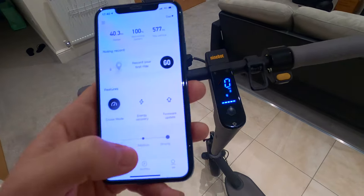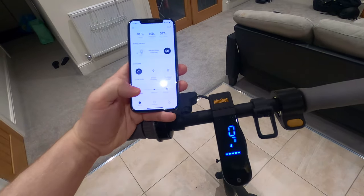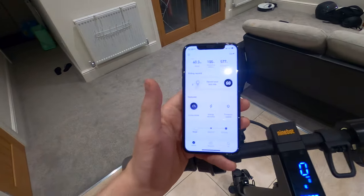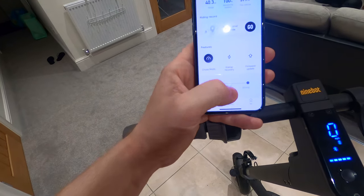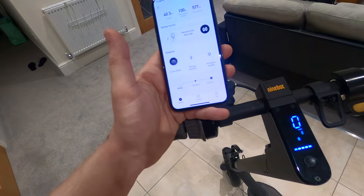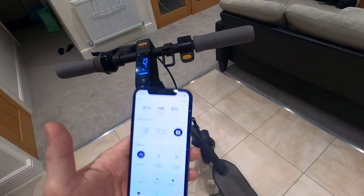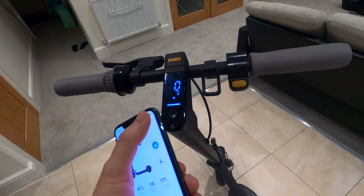Energy recovery level — you've got weak, medium, and strong. I prefer weak because I get more free rolling, like coasting down a hill with a little bit of regen. In reality you don't get much regen on the scooter anyway. In a very hilly area, strong might help, but if you're fully charged you don't want a lot of regen going into the battery as it can destroy or burn out the controller.